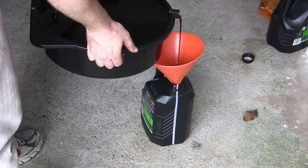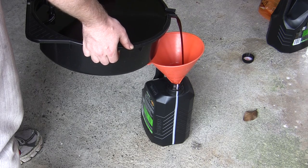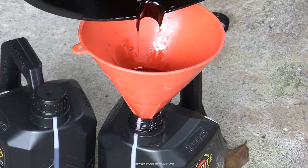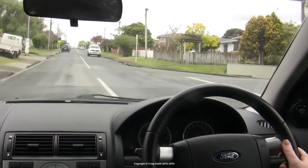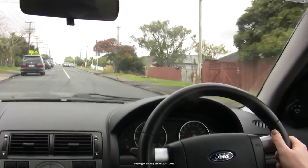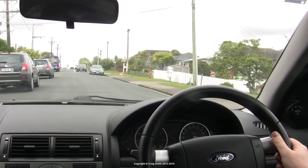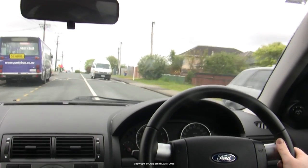All that's left to do is get rid of the old oil — pour it into waste containers like the new oil containers, then take it to an auto store which usually has waste oil collection bins. You'll notice there was no transmission oil filter featured in this video. That's because the CD4E filter is located deep in the gearbox innards and you don't really replace it unless you're rebuilding it, so no need to worry about it when you're just doing an oil change service like this one. I hope this was helpful for somebody — have fun out there.